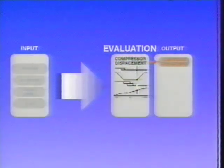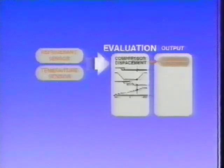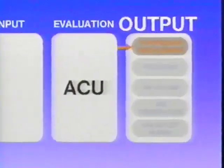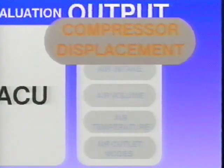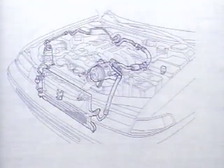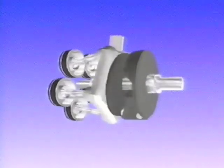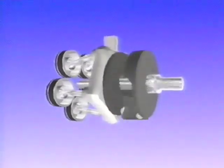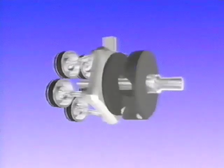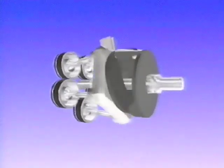The compressor displacement output is developed from either the evaporator or refrigerant sensor inputs, not the composite signal. The DCW-17BE variable displacement compressor is a five cylinder wobble plate compressor. The angle of the wobble plate determines the stroke of the pistons. Longer strokes equal greater capacity; shorter strokes equal less capacity. Displacement can be varied from full 100% capacity to a minimum displacement of 5%.